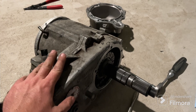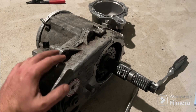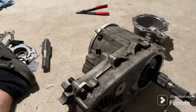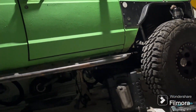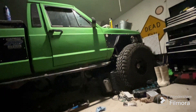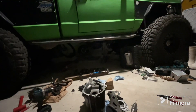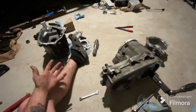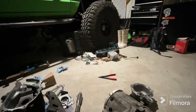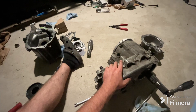This one is just under an inch, so we're good. Everything works the way it's supposed to. I'm gonna put the speedo gear back on, put the oil pump back on, do the silicone on here, let it cure up for about 45 minutes to an hour, then torque everything down and it'll be ready to go back into the Jeep. Right now everything's a mess — we moved, we're in a two-car garage, working on the floor without a bench. It is what it is — you roll with what you got.